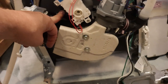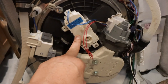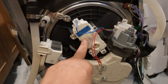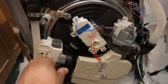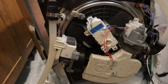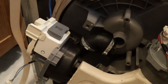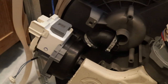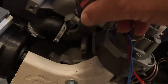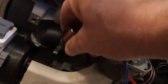We have to disconnect the hose that's in there. I read that this piece has to come off to get access to the hose — whatever this piece is. This apparently just slides out. I've already unclipped the power. So I've got that thing off — apparently it's called a diverter, and there's a shaft on it. You do not want to turn that, otherwise it won't go back in. I managed to get the hose undone — I just used a pair of needle-nose pliers to bend these tabs back and she popped off.